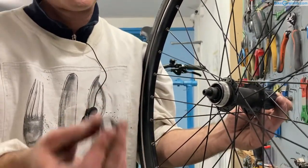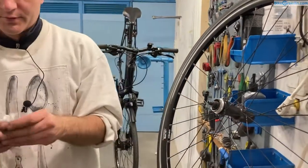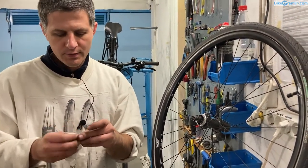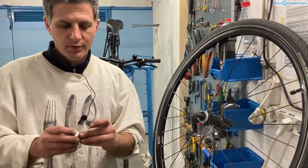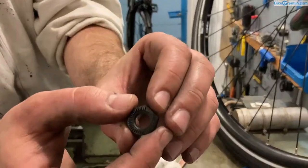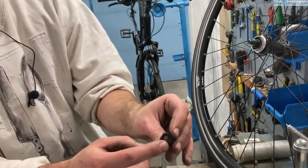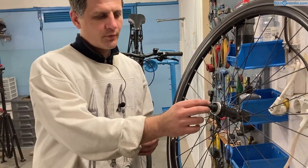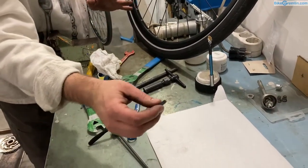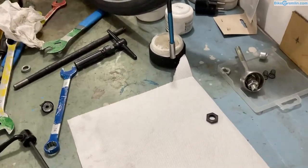Here is the lock nut. Whichever part I remove, I clean it right away. You need to be careful whether parts are symmetrical or not. This one has a serrated outer edge to keep the wheel in place in the frame, and the inner edge that puts pressure on the cone is smooth. The way I usually do it is when I remove a part I put it on its back so I know which way it goes. I put left hand side parts on the left side to avoid mixing, because it's often not symmetrical.